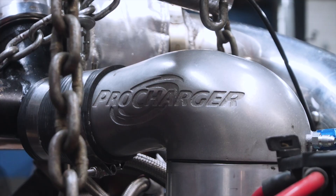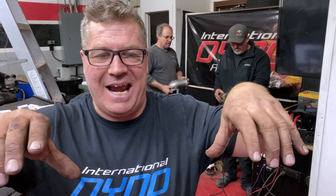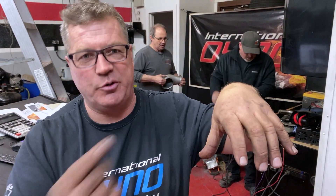On a carburetor-style intake with a turbo on a small block, you have what's called a hat — it goes right down to transfer the air charge into the intake. The hat is a little bit too long in this case, so they want to change the angle going to the turbo so the turbo housing doesn't have any stress on it. That's the adjustment they're making right now.